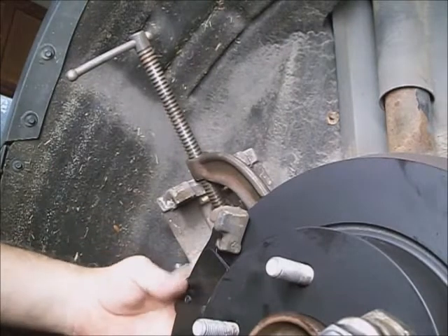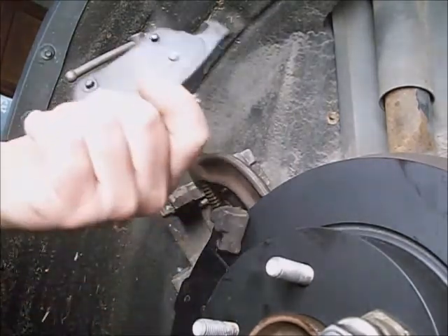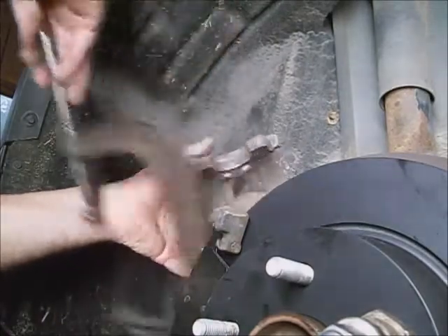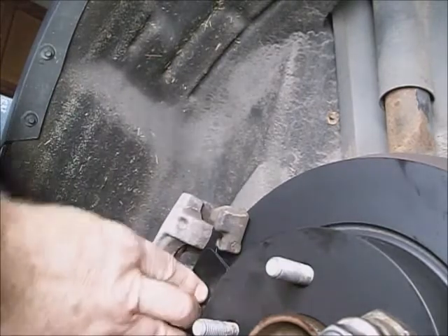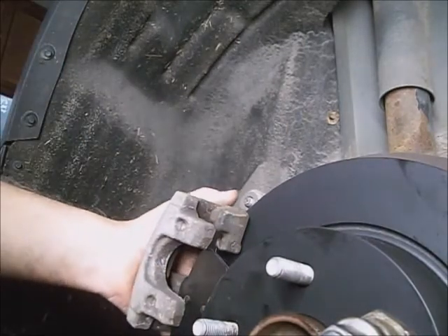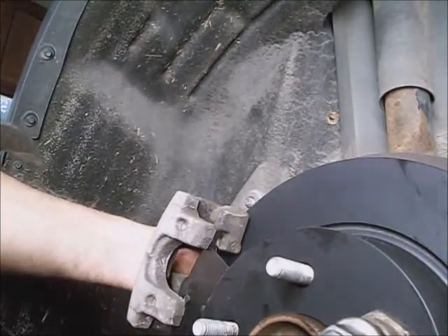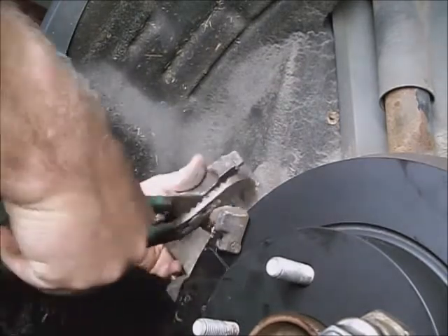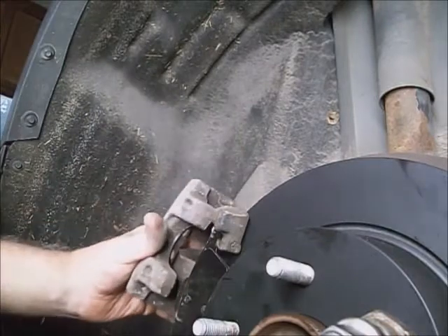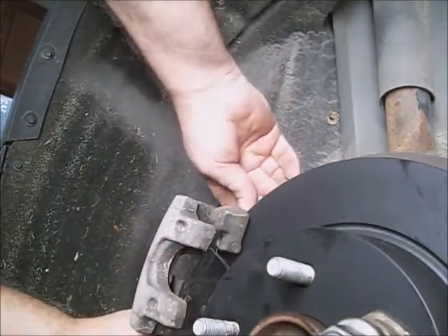It's retracted. There's no pin sticking up on the brake pads, so it'll set in this smooth area between these fins. You can screw it down in there until it fits or it stops. Looks like I've got about there. You can kind of tilt the caliper at an angle and load it, give it another turn. When you get it, make sure your pins are pushed back flush with the rubber they're sticking through.